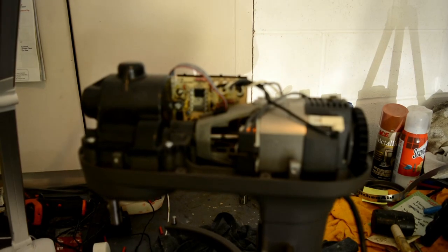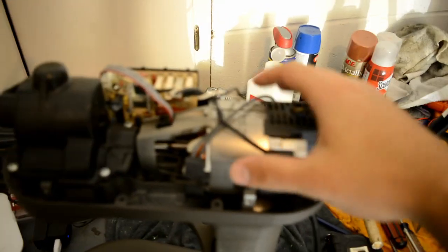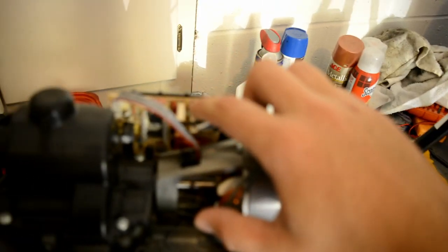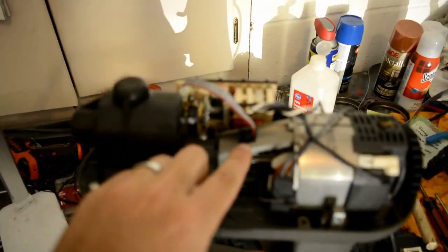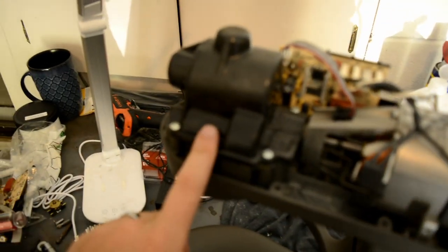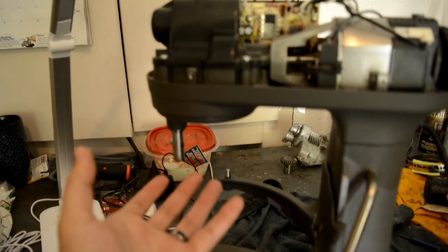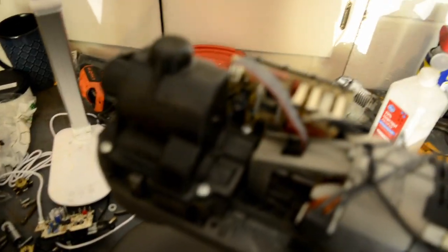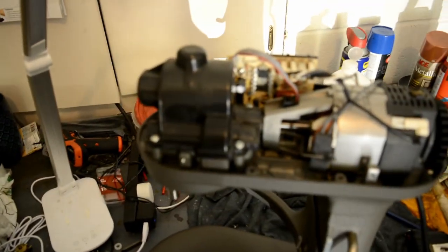Now that we have the top off, I want to take a quick second to show you what we have here — we will do more videos on all of this stuff. This is your motor. You've got some wires coming off of it — these are the power. The power cord comes in down here, connects to the motor. The motor runs to what is called the speed control board — that's that right there. Sometimes that goes out on these machines. That's what the side lever knob that controls the speed goes to. We have the hall sensor here — sometimes that can cause issues. But today we're going to be looking at the planetary.